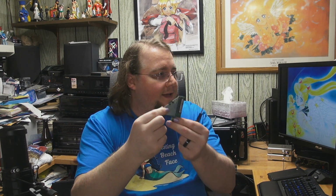And this is the SATA controller here. It's got this little plastic backing on it to try and keep the two PCBs from touching each other, so there's no crosstalk. But this is cool. I mean, you could keep this, and you could effectively turn any hard drive you have into an external USB drive. You just gotta plug it in to the SATA ports on here. It just plugs in like that, and then now you just got to get the USB 3 cable and the power cable, which comes in the box, and now you've basically turned your drive into an external USB drive.